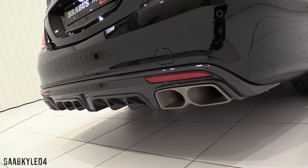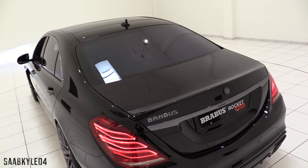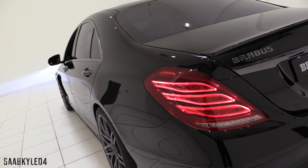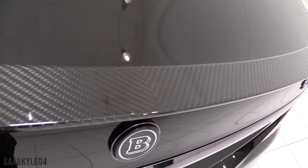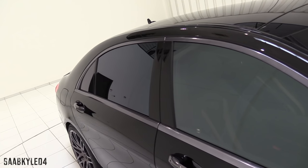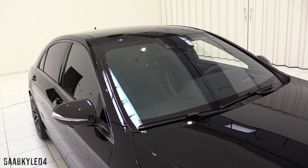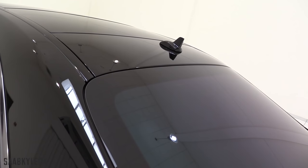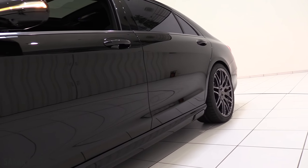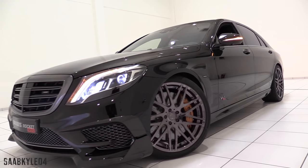The dimensions haven't changed much, an increase in height of 0.8 inches and width by 1.1 inches, with an improvement in weight distribution to 52% in front and 48% in the rear. AMG cars utilize a lithium-ion battery, which saves about 44 pounds over a traditional battery. High-performance carbon ceramic brakes are available for greater stopping power and resistance to heat. To make the car even more engaging to drive, AMGs in general feature unique suspension geometry, with greater negative wheel camber, a larger rear anti-roll bar, and stiffer lower subframe. In the US market, all-wheel drive is an option for the S550 and standard on the S63. The S65 is offered exclusively in rear-wheel drive.